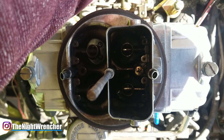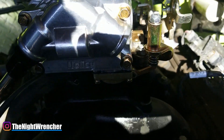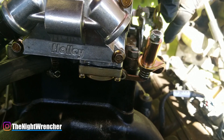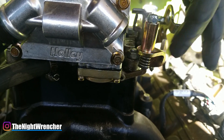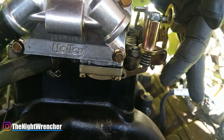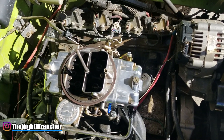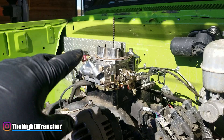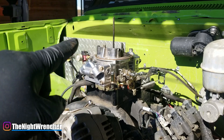I've already primed the fuel system — let's see if it squirts. I'm not sure if you guys can catch that because it's so dark in there, but it looks like it's working fine. As you guys can see, when you stomp on it the accelerator pump arm has this little spring that retracts back, and then the nut drops back down as pressure is relieved. That's what makes the 50cc accelerator pump such a great upgrade. I'll have another video of me testing it out, but right now I've got to install a set of LS2 coils — so I'll see you guys in the next one. Night Wrencher out.